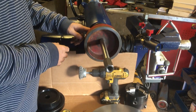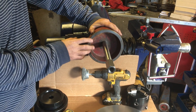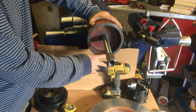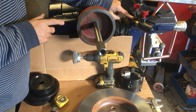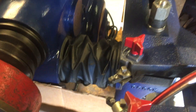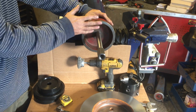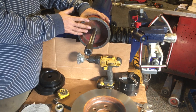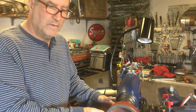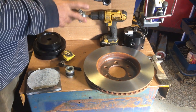So if this cup is clean and the shaft has a little bit of clearance on it and it's still not straight, this cup might need to be cut. You would simply — I'll cover this in another video — take out one tool from the twin cutter, tip the twin cutter at an angle, and come in and cut this face perfectly. Then you know that your cup is true. This cup I already know is true — I've measured it. So everything that I put on here, as long as the cup is clean, the arbor is clean, and the rotor or drum is clean, it'll be straight.